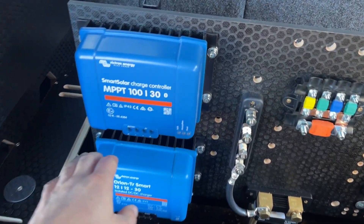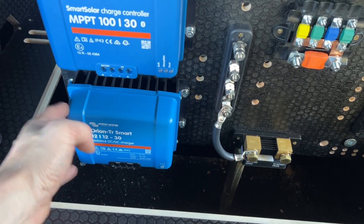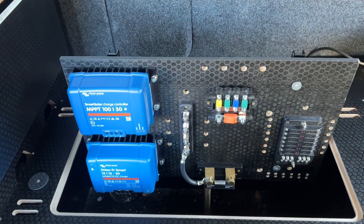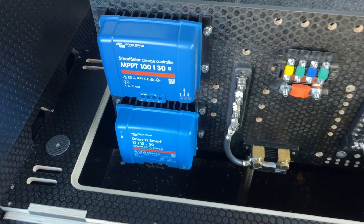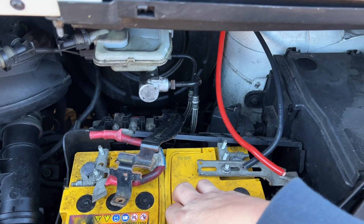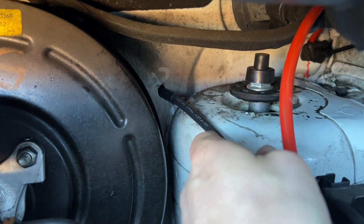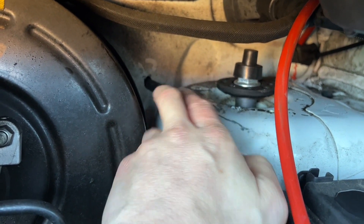The first thing you're going to do when installing your DC-to-DC charger is put it on your electrical board, find somewhere good for it to go, and then think about running cables. Mine is in my electrical cupboard, and my cupboard moves up and down and folds away. I'm going to show you how to run the cable through the vehicle and through the bonnet. I had to drill a hole through the bulkhead there — it took me about 30 minutes to be sure it wasn't going to be in the wrong place.